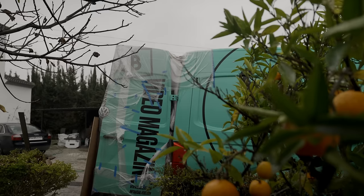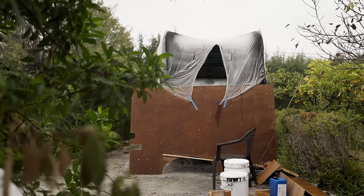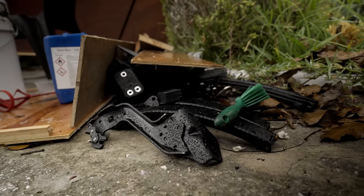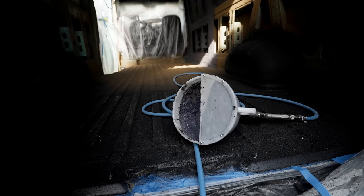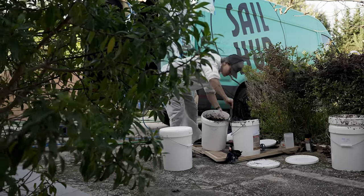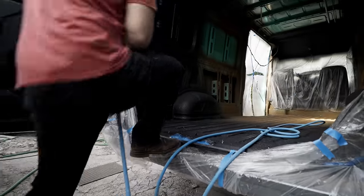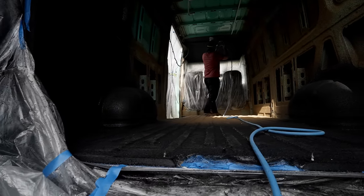To get good results, projected cork requires a relatively low humidity of around 80% or below, and a temperature above eight degrees — that allowed a good cure between coats. When the rain came down we had to stop, and like smart sailors we sat out the storm. After dialling in our settings, we used two and a half bar of pressure on the compressor and added water to the cork mix until it had a consistency similar to lumpy cream — 50ml of water for each 12kg mix. We used Sea Cork's own black pigment for the second coat everywhere, which made it easier to see coverage between layers. This technique applies the same for both boat hulls and vans.